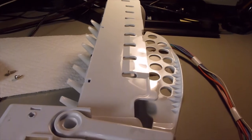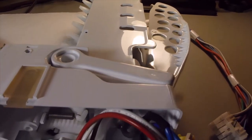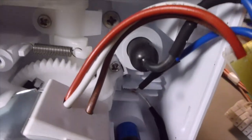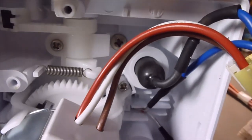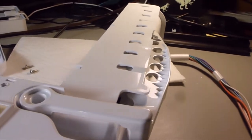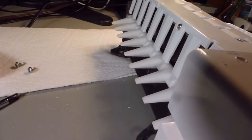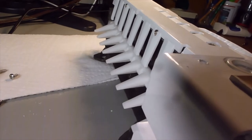The arm drops down as usual. There's a little magnet on that sprocket down there, and the magnet on the arm up in the top left, corresponding to the sensors on the board — and there's the snap, indicating the fingers are rotating the wrong direction, so the motor is reversed for some reason.